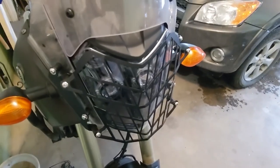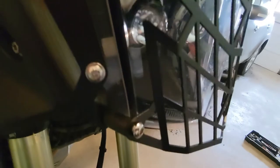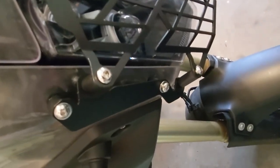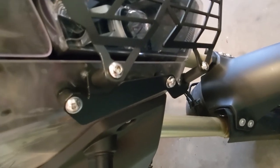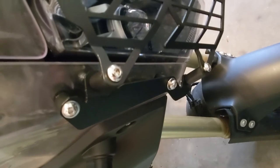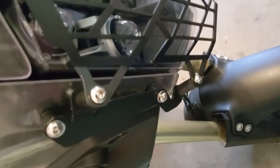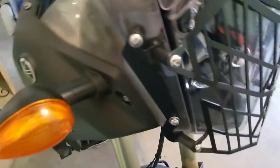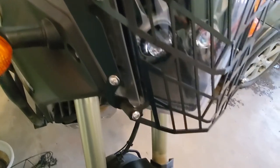That's all four bolts in — the guard is now connected to the bike. These two bolts attach the grille to the bike, and those two bolts attach the guard to the bracket. I really want to stress that the orientation of the brackets is critical, otherwise you'll be very frustrated. The little dog leg is at the bottom, the extra tab is at the top, and the tabs and the bottom bolt hole should bend into the bike, not away — otherwise it won't line up correctly. It's important to leave all the bolts loose, particularly the ones that mount to the bike. When you get the top two in, leave those loose, otherwise you'll have a really hard time getting the lower bolt in.